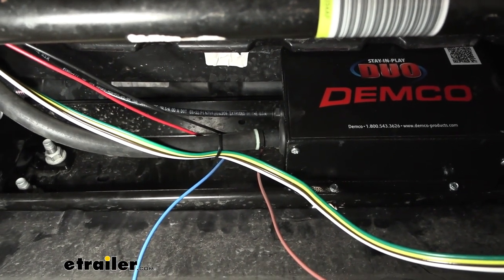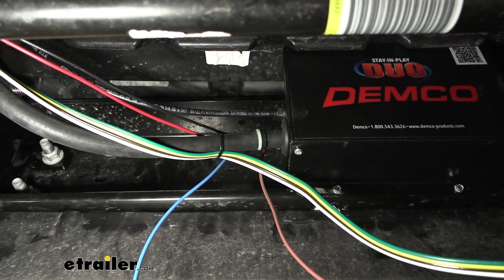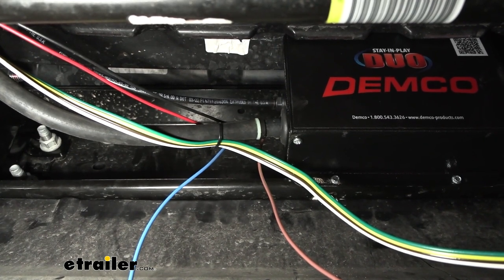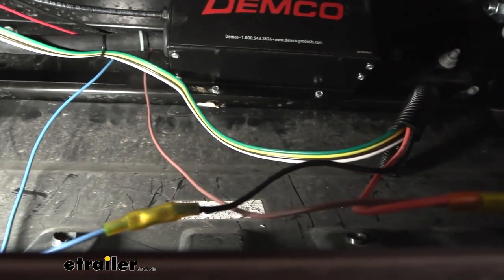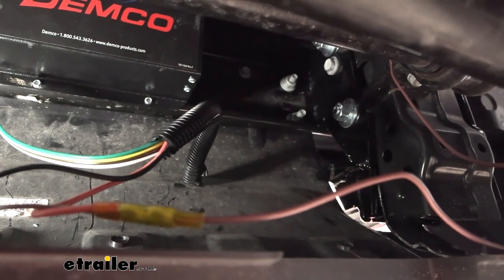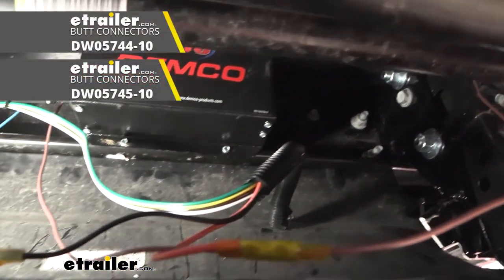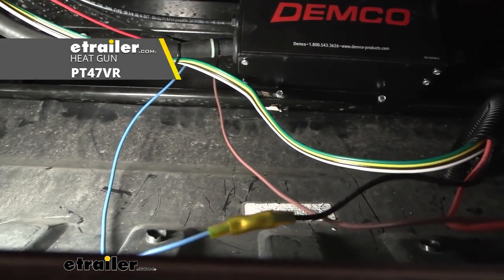To make our wired connections, start at the operating unit where you have four wires: blue, brown, red, and black. Blue and brown connect to the breakaway switch wires, which are black and orange. Red and black make their way toward the G-Force controller through the vehicle's grommet. The breakaway switch's black wire goes to the blue wire from the operating unit, and the orange wire attaches to the brown. All connections outside the vehicle are made with heat shrink butt connectors — crimp them down and apply a heat gun to seal a waterproof connection that prolongs the lifespan of the wiring.